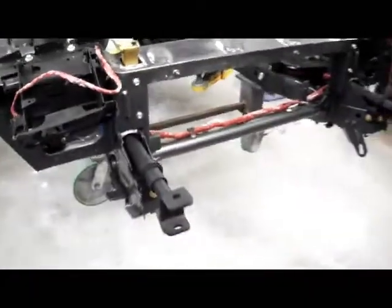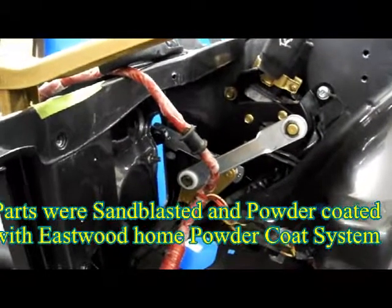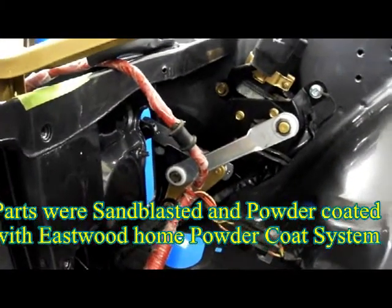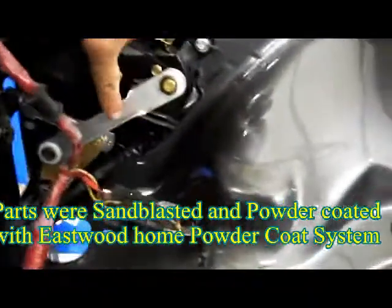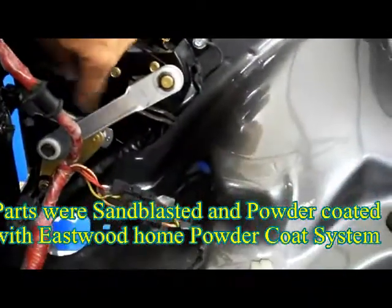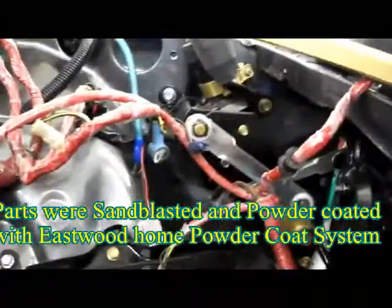The wire harness was re-taped and parts were taken out as they went. One of the most trying things was putting back in these motors for the power operators for the headlight pods — they were just so rusted. I've managed to get these new from Mazda: the drive linkages on each one, which makes it look a little bit more like a new install.